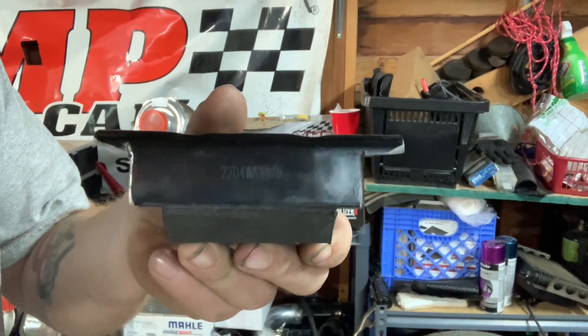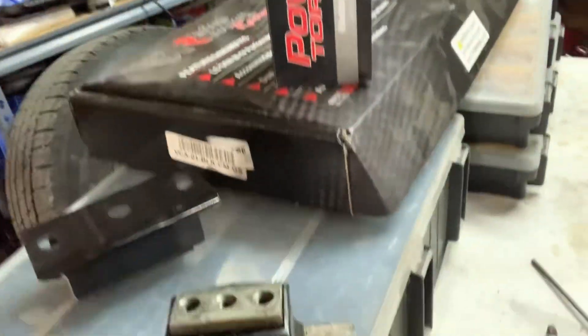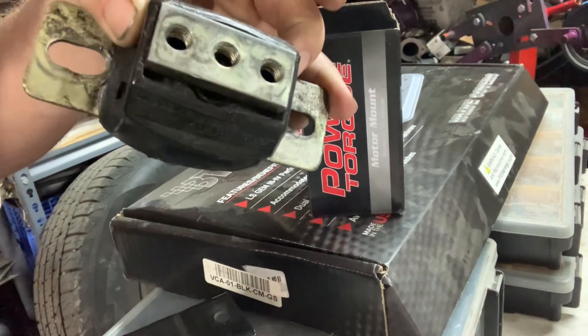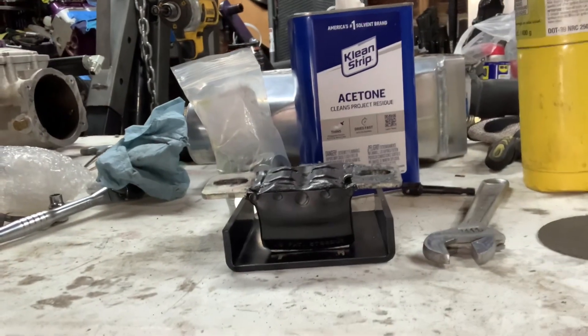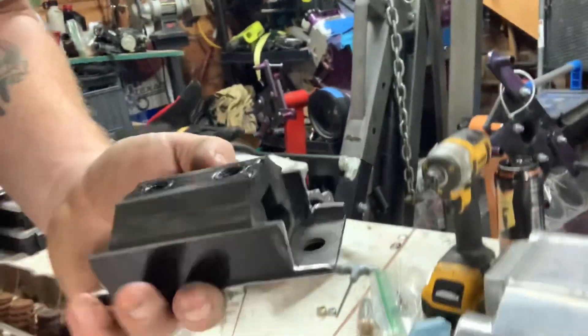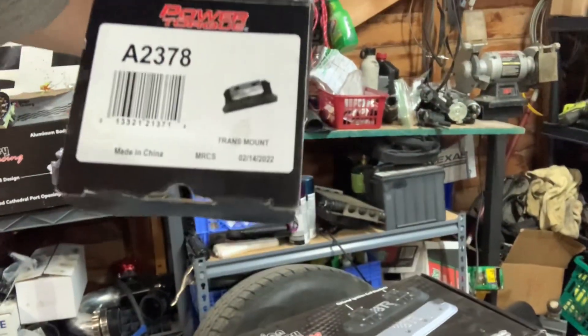What I did is cut little notches on the end here. This is a different style than what we've run for the TH350. This one — I believe it's like a Mr. Gasket or Energy Suspension — is just one season old. We did blow a motor and it got pretty oily, but look how swole it is. It did fit down in the bracket well, which is why we initially used that one. These are about $44 — there's 1036 on it — but we're gonna try this one for this year. If you notch it out, it works pretty well; still have plenty of strength there. That one is part number A2378, if you are running a G-Force TH350 crossmember — those are the two pieces you can use.